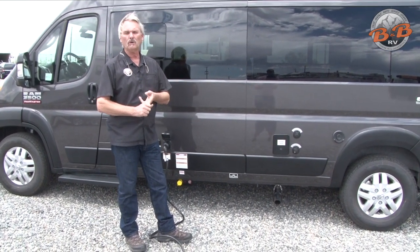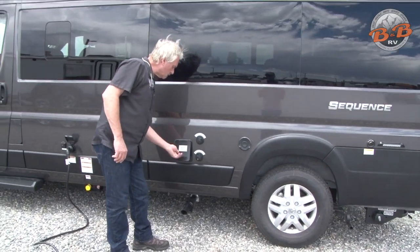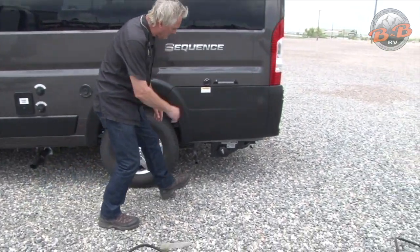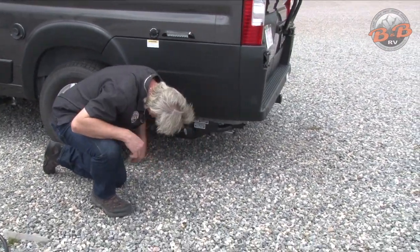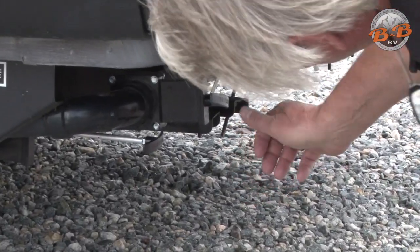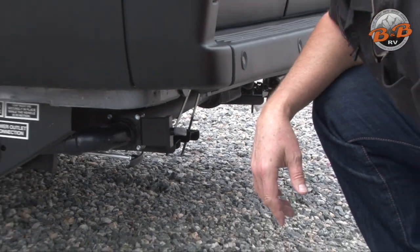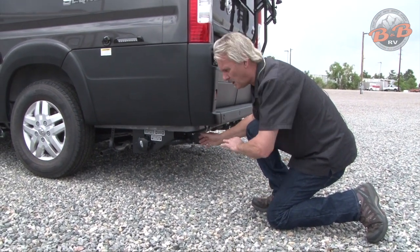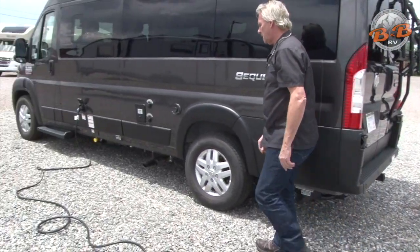You'll have a cable if you want to hook up cable, you have the water hose, dump hose, toilet paper and chemical for your toilet. Out here is where your sewer hose stores. Pull the hose out — it's stored here and you pull it all the way out, bring it back here and put the hose on the connection. Put the hose down into the dump. You've got both valves here in the back. This one is your black valve and this one is your gray valve — just pull those straight out to dump. Dump the black tank first; that's your toilet. The gray tank is your sinks and showers, so it's soapy water that will rinse your hose out. Then take your hose off, put the cap back on, and store your hose back into the storage compartment.